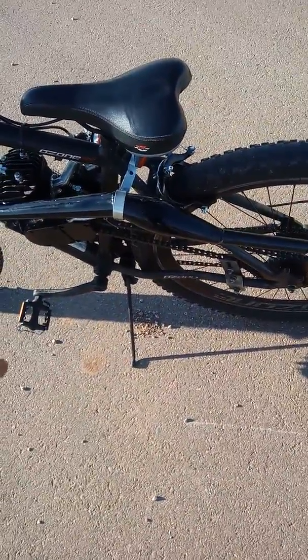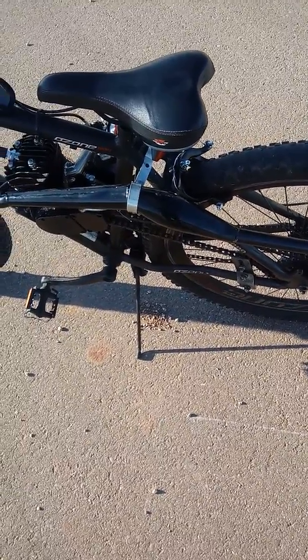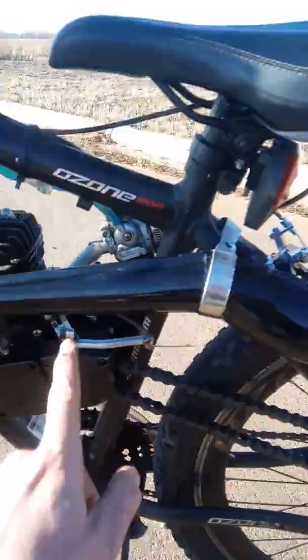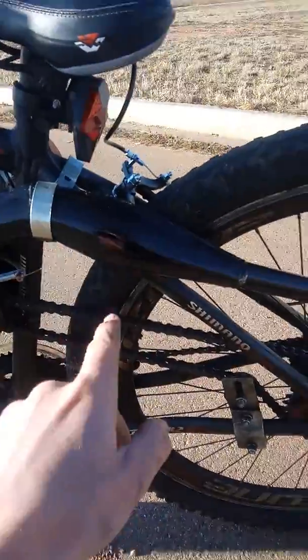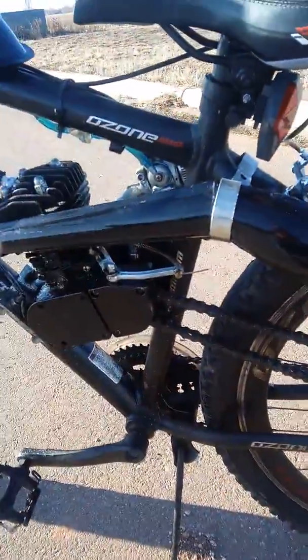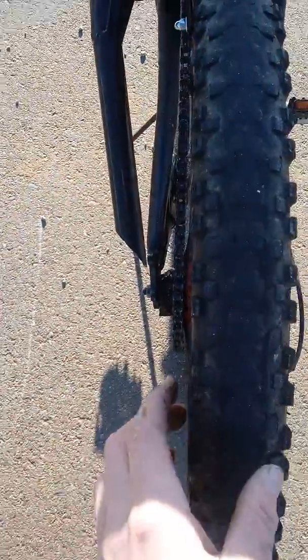They are from Bikeberry — don't be discouraged about them, the only bad thing they make is their engines. So this is the pipe: you have your curve here from the engine, goes up and then points down. This here is your expansion chamber, which is what sends vibration and air back into your engine for back pressure.